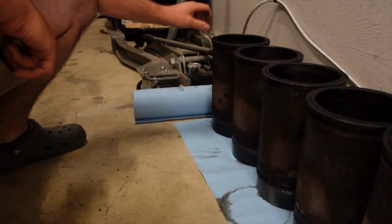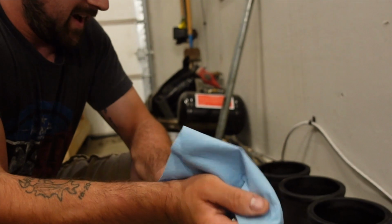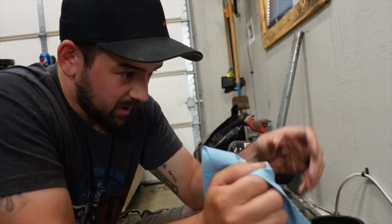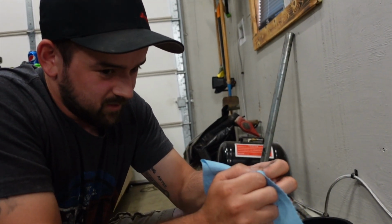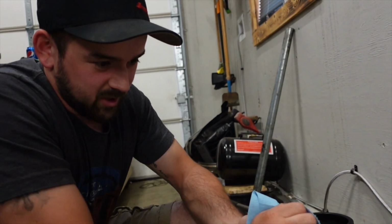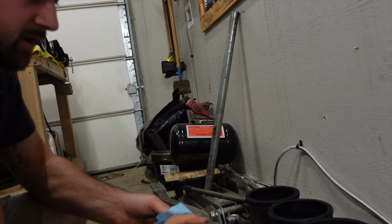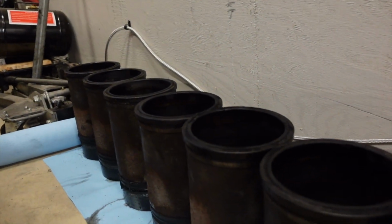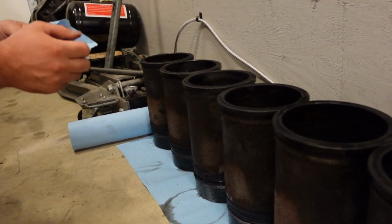I heard you explain it to somebody else, but can you explain it to me? I don't really know exactly, but I'm pretty sure it's on the power stroke, when the explosion in the cylinder goes off, it pushes all the coolant away from the liner and then it slams back into it, basically. And it creates all of that pitting? Yeah. That's a lot of force to blow coolant through. Well, yeah, that's years and years of it. Yeah, I get it.